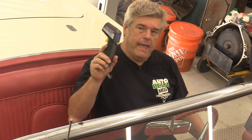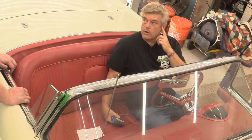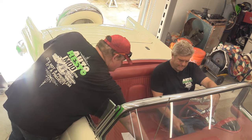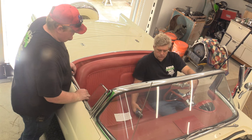56 degrees. I'm using a Syntec infrared thermometer. I actually prefer a small dial gauge to stick down inside the vent for temperature testing, but I can't find ours, so this is the next best thing. About 57 degrees right now. We're running like 35 pounds on the low side now, which is close to where it needs to be. That shouldn't cause any problems with freezing up. Somewhere around 53, 54 degrees.